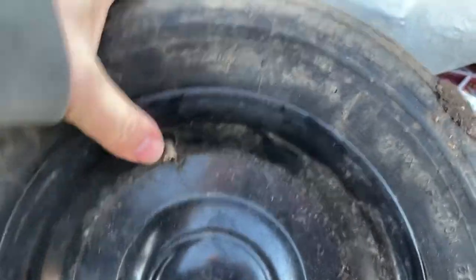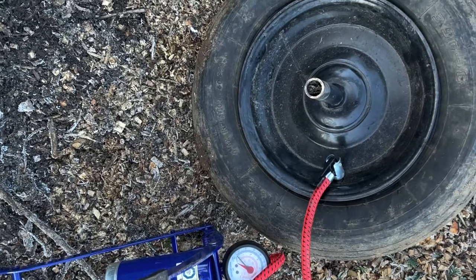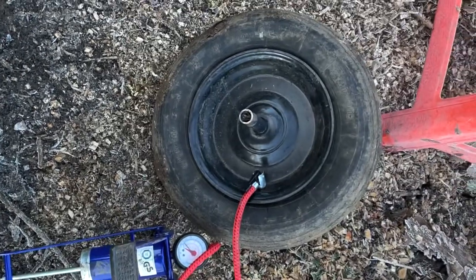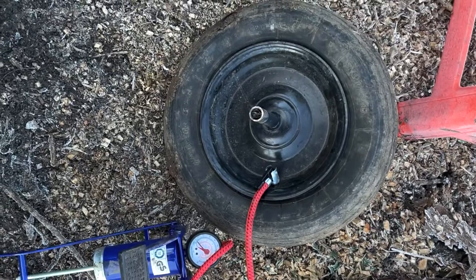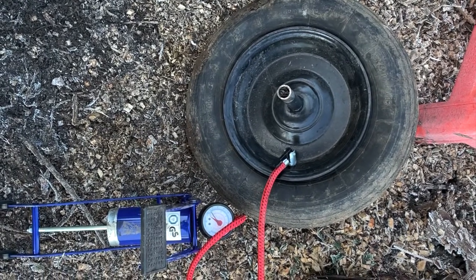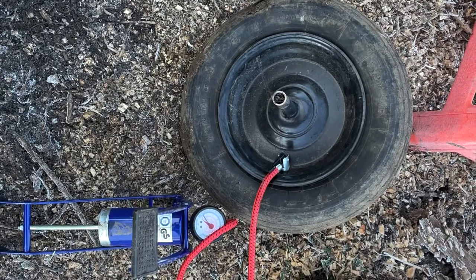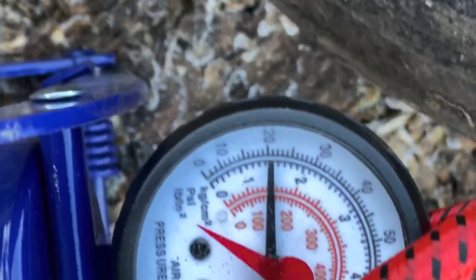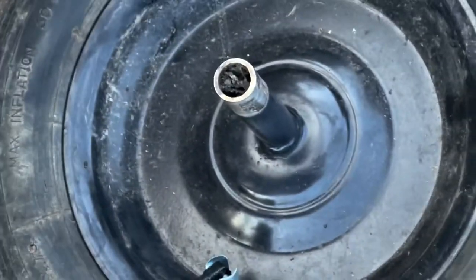I've just got to hope that's nice and flat behind there and I'm going to attempt to blow that tire up. I've got my foot pump attached to the valve. What you should really do is do a test outside of the tire first and make sure it's not leaking, but I couldn't be bothered, so I might have to learn the hard way whether my patch is going to hold. Also, you'll notice it says on the side a maximum inflation number - in my case it's 30 psi, pounds of pressure per square inch. I've reached 20 psi and the maximum is 30 - I'm going to leave it at 20 because it's fairly hard.